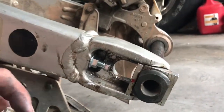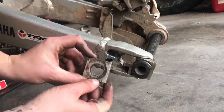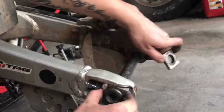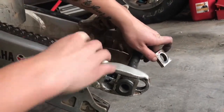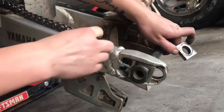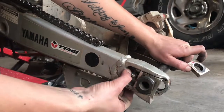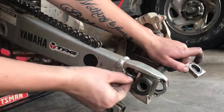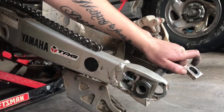So you have these squares — this one goes on the other side. I've put red marks on it so I don't remember which way it goes because it's been off for a while. This flat part is going to hit against this. You have your tire on and your chain; you're trying to get your chain tension. You push this up and it's going to slack it. If you're getting just a little loose and you want it to go back, in order for it to go back you've got to undo your locking nut and twist this out with a wrench. It's tedious.